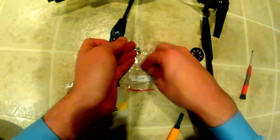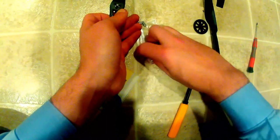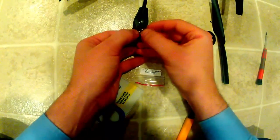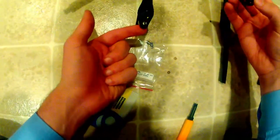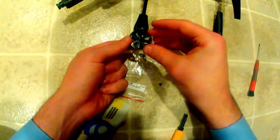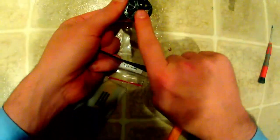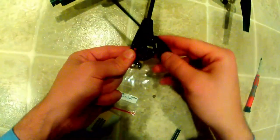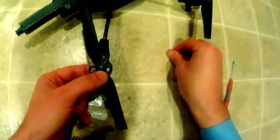Another one here, and just like that. Now I have to keep holding on the bottom or it'll fall through. Replace the gear and make sure it's seated all the way. On the prop, you'll notice there's a high side and a low side that matches, so make sure you put it on in the way that matches. Otherwise it'll be too tall and you won't get the clip back on.